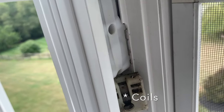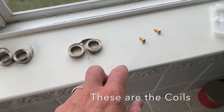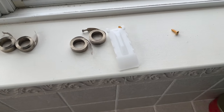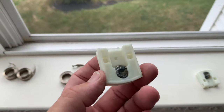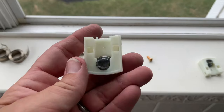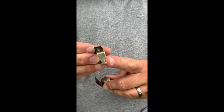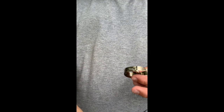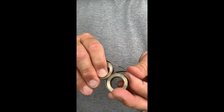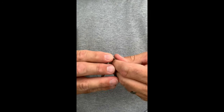The shoe is out now, it's tilted out. I'm going to work it down and keep popping the first spring out and then the second spring and it'll pop right out of there. The old springs are out and the new springs are going in. You need two springs and a screw cover to make each one, plus the shoe. These new shoes have a metal piece inside so they should last longer. You have to get these two end pieces in the same alignment because they go down in one spot in the shoe - slide it around and roll the top spring around the bottom spring.